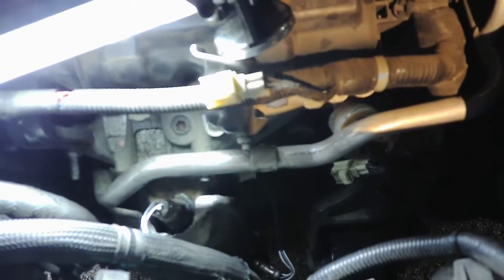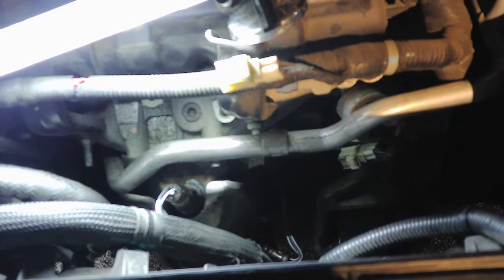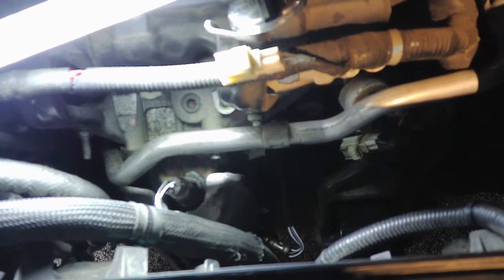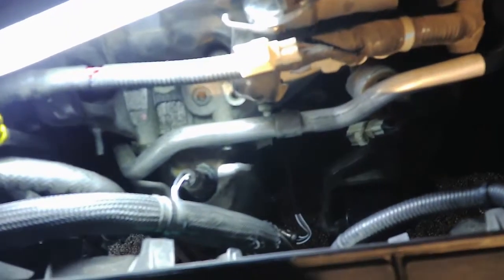The main thing I would point out on this job, other than getting a quality replacement, is you don't have to remove those bottom bolts, but it does help to loosen them a little bit, just to make the converter come in and out more freely. This front one is very doable for most people. The back one's probably going to be more of a challenge, because you're going to have to drop the axle and do a lot more getting up in there to get to the bolts. It's going to be a lot more challenging. So if you have a bank 2 issue on a Chrysler, you're in good shape. If it's a bank 1, it's going to be a lot tighter and a lot more time consuming.